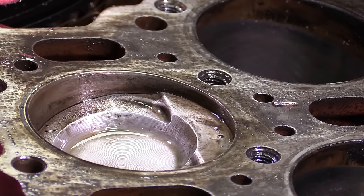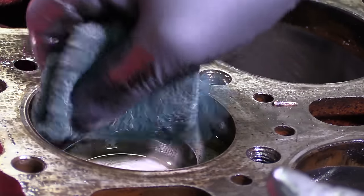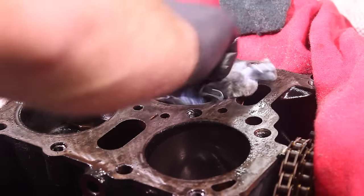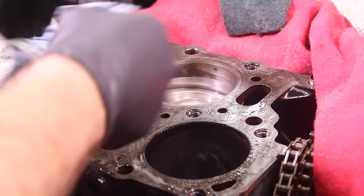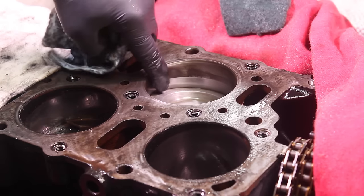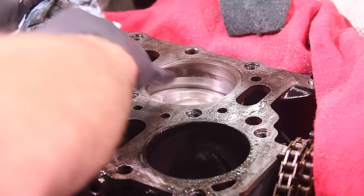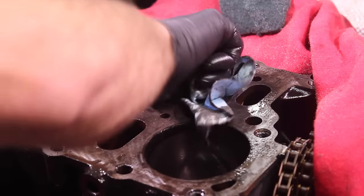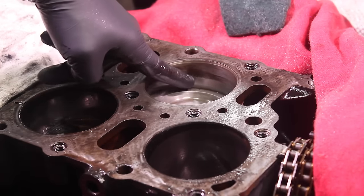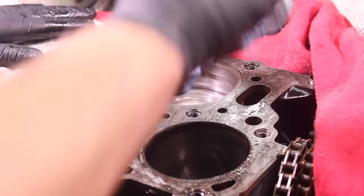Even there, with just a minute or so of scrubbing, you can see our piston here looks considerably different from how it looked before we started. If you need to rotate the engine around to get a little deeper into the cylinder wall, go ahead and do that. Every once in a while I like to take these blue lint-free rags and just wipe it out and see how it looks. Now there may still be a little bit of discoloration in the cylinder wall — that's not that big of a deal. We want to get as much out as we can, but if there's a little bit of discoloration that's probably going to be okay. Remember, this is the combustion chamber, not where the piston rides, so we just want to make sure we get all the carbon off so that we don't create hot spots.